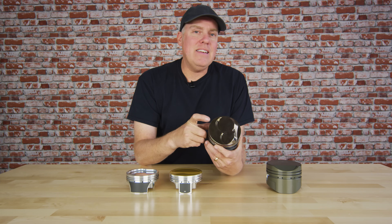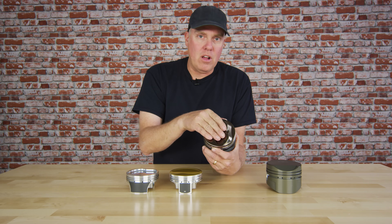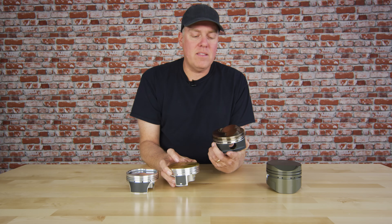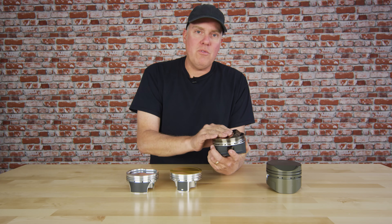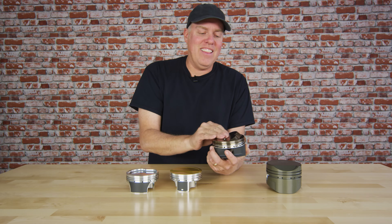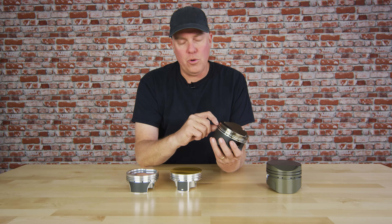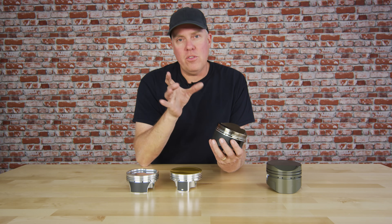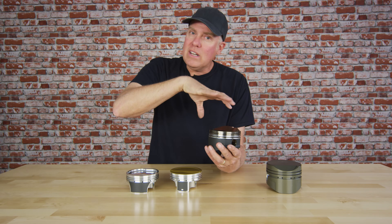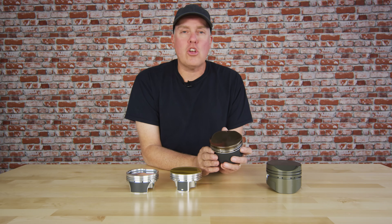More interesting is up top: the Electroless Nickel Plating. This is a very hard, very smooth surface texture that does a couple of things. First, it is heat reflective — it helps protect the dome the same way that the ceramic does. But it's also very non-porous and very hard, so it won't collect any contaminants — no carbon, no little pieces of salt or sand. It'll just reject that right off the piston. It's also a very hard coating that helps the top ring groove. You can get what's called micro welding, where the steel ring moves around inside the aluminum piston and can gall, transferring aluminum onto the ring. If the ring doesn't rotate freely, it can create a sealing problem. The Electroless Nickel Coating helps prevent that.